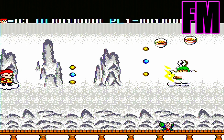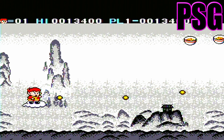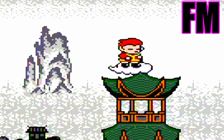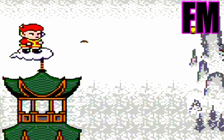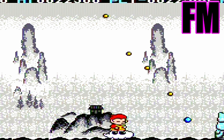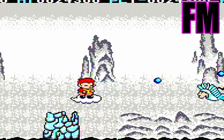When the games were programmed, all games got a PSG soundtrack but not every single game got an FM soundtrack. About half of the Sega Master System library got an FM soundtrack. So one thing to note is that this mod, or this chip, does not support every single Sega Master System game — it only supports about half of them.